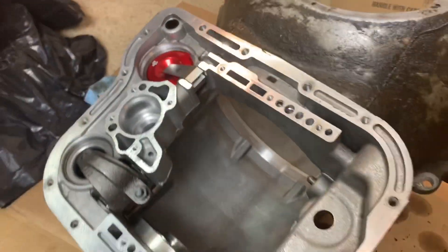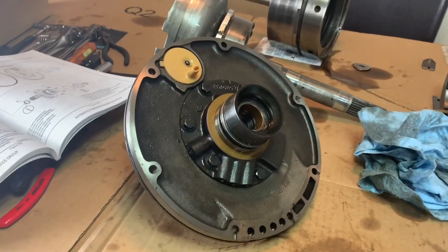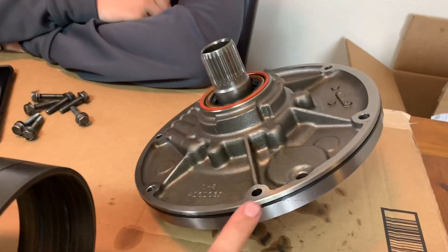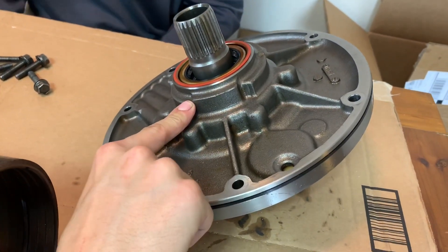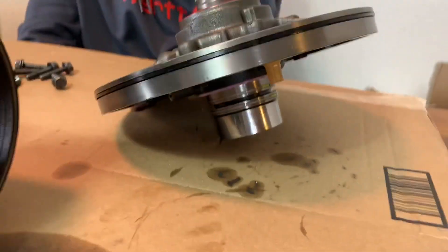The case is pretty much ready to go. Now I'm going to move on to rebuilding the oil pump. We just got the oil pump done — it is fully rebuilt. We put a new O-ring in there, a new input seal, as well as the bushing that goes inside of it. There are also two new sealing rings on the oil pump, so that's completely rebuilt and ready to go.